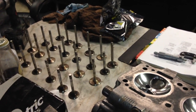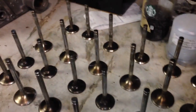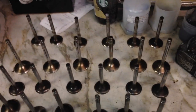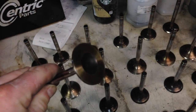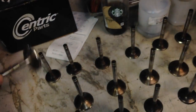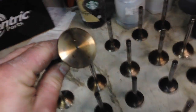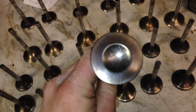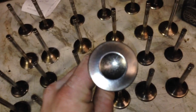Then it's going to have to have a three-angle valve job done on it. I have all the valves from both engines — all cleaned up on the bench grinder — and I'm using my micrometer to determine which of all these valves are within service limit. Those valves within service limits are going to go to the machine shop to get the three-angle job done. The exhausts look okay — these are from the 164 engine and these ones are from the Milano's old engine. They look pretty good, not terrible.